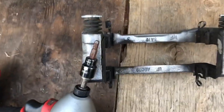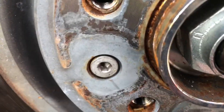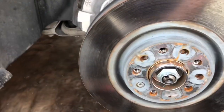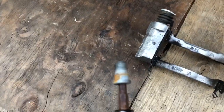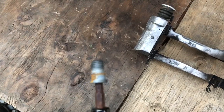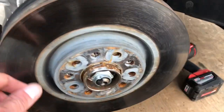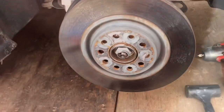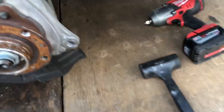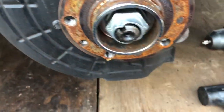Now we're left with nothing but the rotor. You're going to need a number 5 hex — it belongs to this little set screw right here. Go ahead and pop that out. Set that aside with your other stuff and now you should be able to just pop the rotor right off. It might be on there a little rusty, so give it a little whack. I had to use my dead blow and give it two taps and it finally came free.